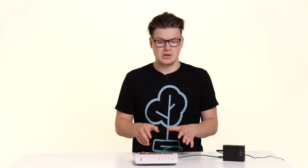If this hasn't happened, pull the power cable out of the back of the Fritz Box, wait 20 seconds, and plug it back in.